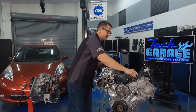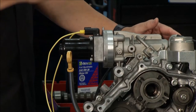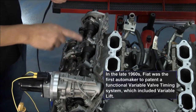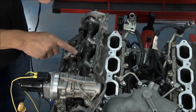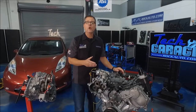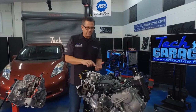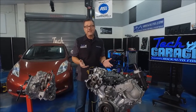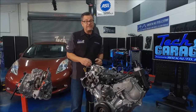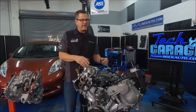Now we'll take it one step further — talk about new technology, this is phenomenal. You saw the variable valve timing where we can move the camshaft. Well this motor can vary the lift as well. It's got a variable lift motor right here, and our chief tech Josh was kind enough to wire it up so we can run it and you can see it in action. Watch these camshafts right here and then this fulcrum — when I push this button the fulcrum is going to move. And what's happening when it does that is you're actually varying the lift; the valve is opening further. Why do you want to do that? Well an engine kind of acts like a human — if you're running real fast it's gasping for air. The valve is going to open further and allow more air-fuel charge in. Bigger bang. Now we don't need to do that at idle, so we can have the valve not open so far, and you don't get as much charge in there, but it runs optimal at either low speeds or high speeds. So not only do we have VVT — variable valve timing, moving the camshaft — we also have VVL — variable valve lift — changing the lift of the camshaft, and we've got performance second to none.